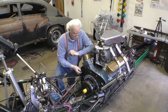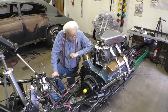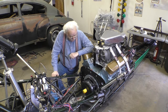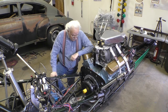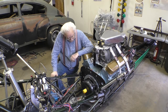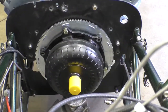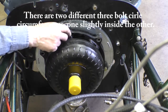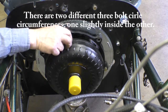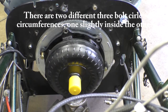And in case you haven't noticed, on the back of this mid plate there's a scratch, there's a huge gouge. And that gouge was caused when the 3 bolts sheared in the final round at Norwalk. So we went to a 6-bolt flange. The problem is that there's already a hole drilled here, and if I drill a hole for this flange here, it's going to be halfway into the other hole.